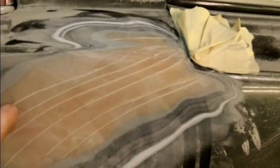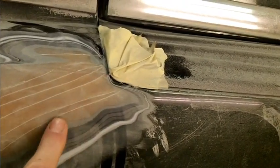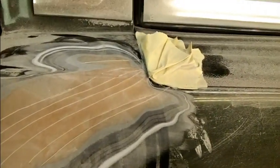Okay, they got all the paint stripped off, and I chased those cracks with a utility knife. And up here must have been the point of impact because it's really deep. And because it wasn't repaired right, it just kept spreading. So I'm going to V all that out, and we'll bring you back in a minute.